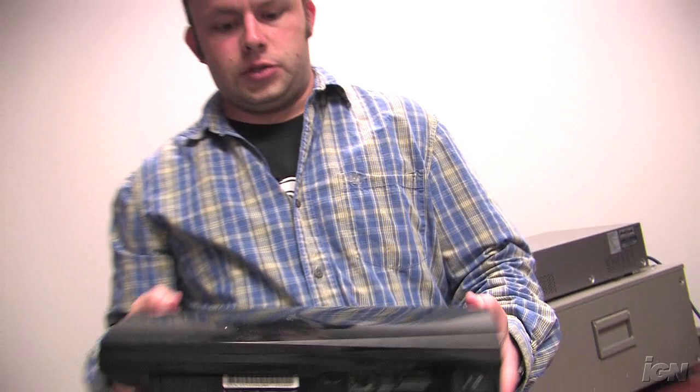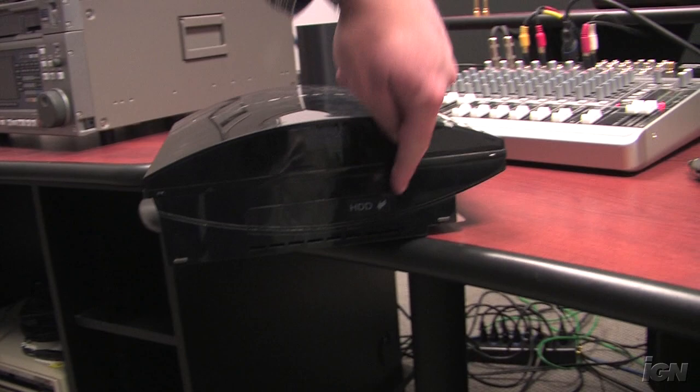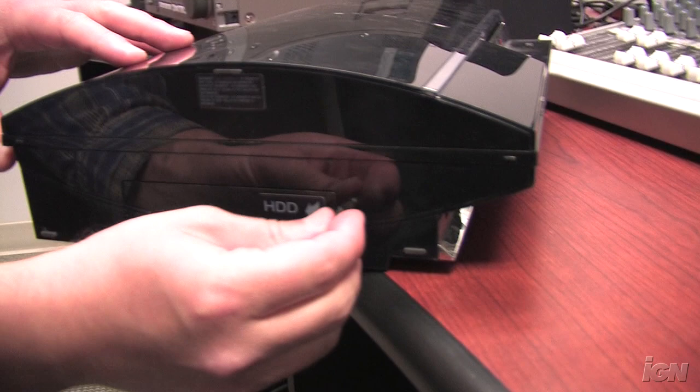So here's the PS3. If you turn it this way, you see the little thing that says HDD — that's where the hard drive goes. You stick it right here. Now what you want to do is, there's no screw here, you just pop off this cover on the right side. There's a little tab over here, so I'm just using a little flat head bit — I'm just going to jam this in there and it'll pop out. See, there's a little tab here. Here's your drive inside of here.